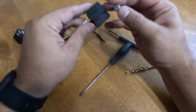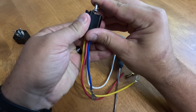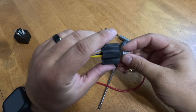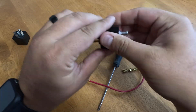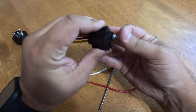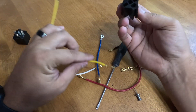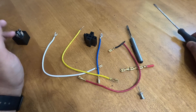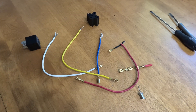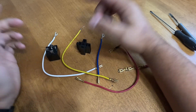You can do this with a small screwdriver, a thumbtack, or even a hairpin — same concept. Insert from the front, pull out from the back. A lot of pre-terminated relay holders come with five wires but many applications only use four. If you're trying to clean up the wiring, don't just chop it off — it's a lot easier to just pull the pin out. No special tools needed. The better you get at wiring, the better you can troubleshoot things and save yourself time and money.